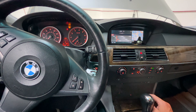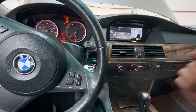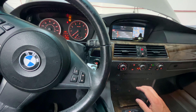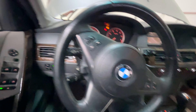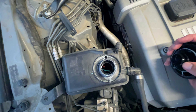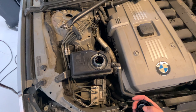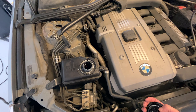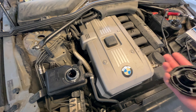I can hear it working already — I can hear the bubbles going through. What having the heater open does is cycle fluid through the heater core, get all the bubbles out, and through the whole coolant system. You can see it squirting there. The level is low because the level stick is at the bottom, but there's enough coolant sufficient for the bleeding. Once it's done, I'll top it back off again, drive it, double-check for leaks, and make sure the heater works and also the air conditioning — because that's the whole point of this repair on this particular vehicle.